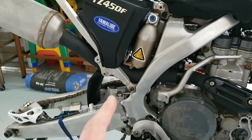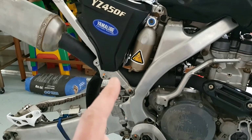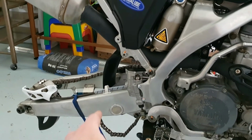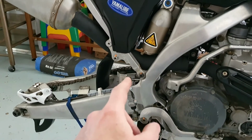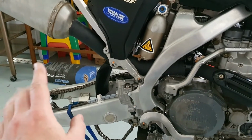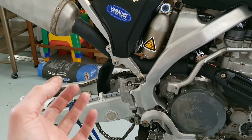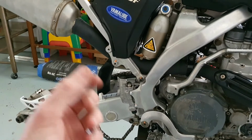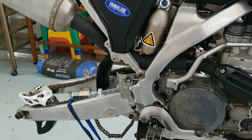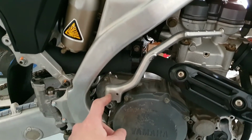Shock, not rebuilt, but new seal, new pressure. And then we get to anything that contains bearings, from wheels, linkage, swing arm, shock, all brand new, okay? One of the linkages, I took it apart, I was greeted with a dust cloud and the sound of the needle roller, the needles just falling out. Like no grease anymore, nothing. And unfortunately, this was the issue with some of them, especially taking off the Kickstarter.